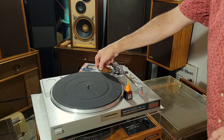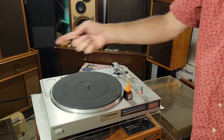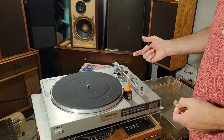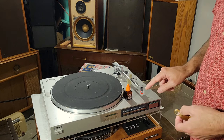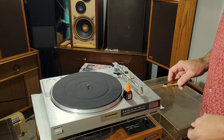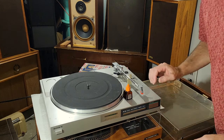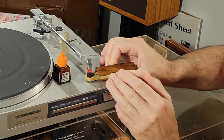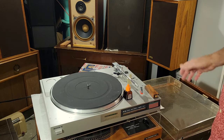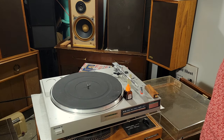I have not even plugged the power in on this turntable, but I've simply plugged the cables into my amplifier. There is essentially no electronics involved with getting signal from here to the amp, so even with the power off I should get some response if the connection's good. All right — no sound. His diagnosis appears to have been accurate. No signal getting from here to the plugs anyway.